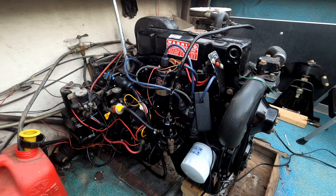And it ran fine. And the funny thing is, before I started making these last two Mississippi trips on my other boat, I fixed that, got 12 volts going to the coil. Guess what? Runs exactly the same. No performance difference whatsoever. So that's why I wasn't afraid to start this one up without removing that resistance wire from the coil. Works just fine.